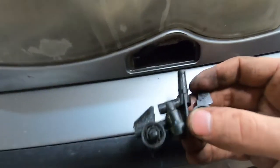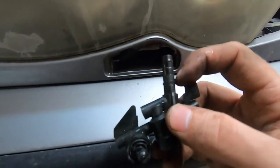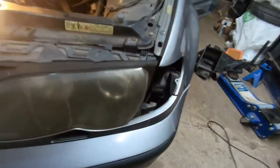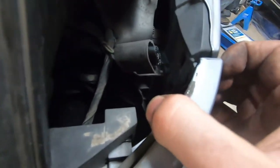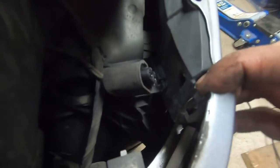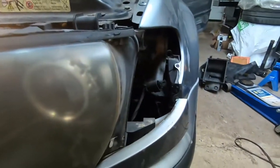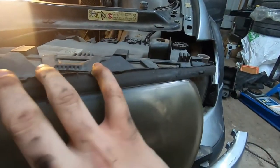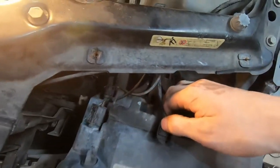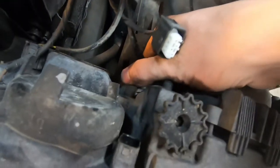You don't really even need to pry — just hold the plastic hose and hold the fitting and pull them apart; they clip together and come apart easily. Next, undo a couple of clips back in here — it just clips in and you pull it out. On the other side I had to push the plastic nub in to get it to release, but this one comes out easily. Then the whole headlight unit pulls out, and you just undo all the cables. BMW connectors are easy — push the little tab and pull back. There are about four of them with tabs on the bottom.